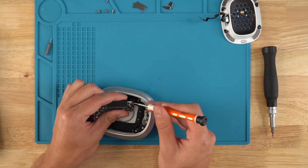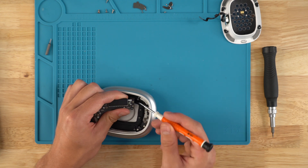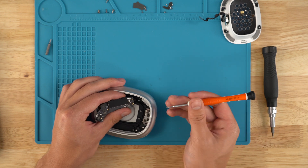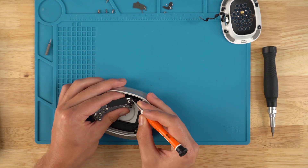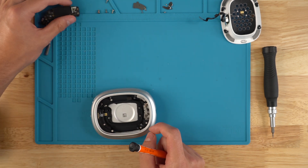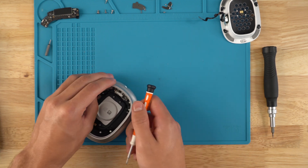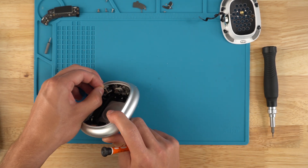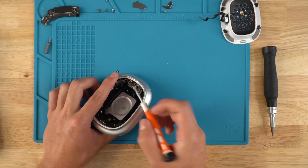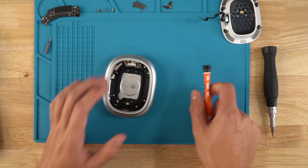Now I'm going to pry this clip, which is the headband jack clip that goes into the Bluetooth board. I went in and used the metal part on the Bluetooth board as leverage and peeled it to the side. Sometimes you'll have to struggle with it, going a little bit on each side until the clip is completely off. Set that to the side. Now we're going to grab this — it's the headband jack ribbon — and it's clipped in right here into this little section. Just pull it out to make it loose.